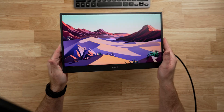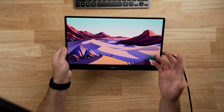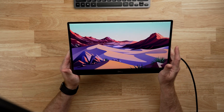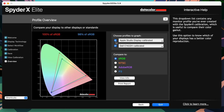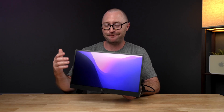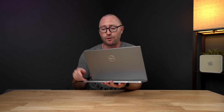The display has a matte coating on the screen and Dell says it can get up to 178 degrees of viewing, but there is quite a bit of brightness drop-off as you move to the side, so it is not great — but it is fine if you are looking at it straight on in a regular office setup. Color-wise, this panel gives you 98% of the sRGB color space and 75% of P3 color, which is not fantastic but not bad as a secondary display. It gets up to 300 nits of brightness — 311 in my testing — with a 700:1 contrast ratio.